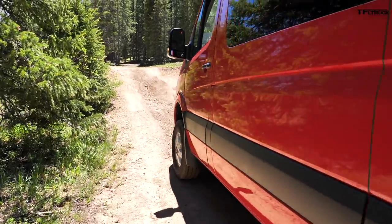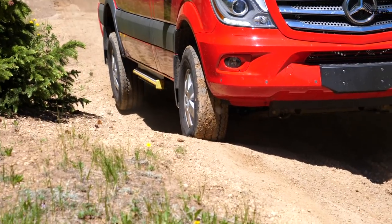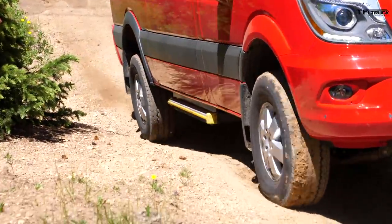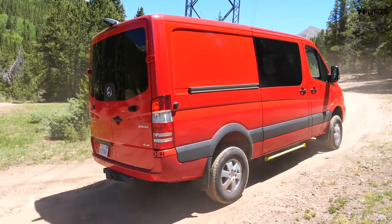This looks like a little bit more of a challenge — it has some articulation, it's got a little bit of off-camber, and it's fairly loose sand. Taking it straight on. We don't have locking differentials, right? That's exactly it — so what it does is grab the wheel that spins. And we did it! That was a little bit of a challenge. One of the reasons why we didn't take this van up Goldmine Hill is that it's just too tall — the trees come over and we would hit a tree without a doubt.